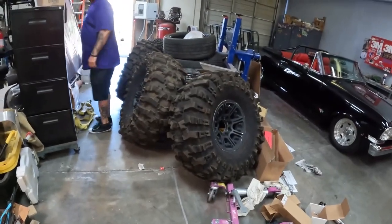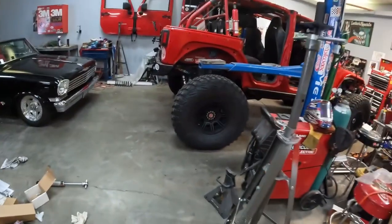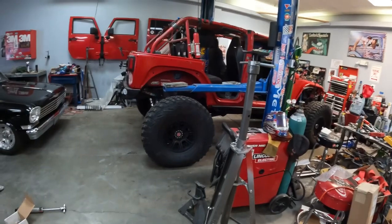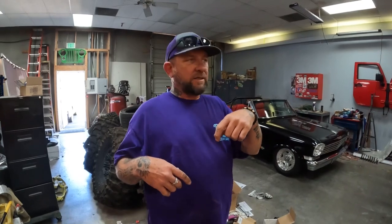Is this rock climber stuff here? Yeah, these go on that one there — that's the one with the LS in it. That's when you stopped by on the way back from Florida. They just draped it over the dipstick tube, probably to stab the motor, and never secured it. You know how heavy those things are? So this thing's going like this all the way down the trail, rubbed the siding off the wire, shorted out. Luckily I was at my house, not on the Rubicon, because then I would have had to Chinook that mother out of there.